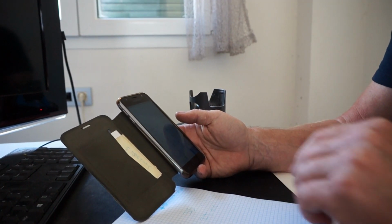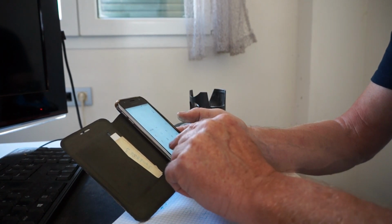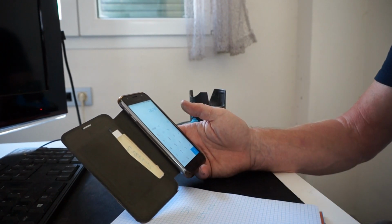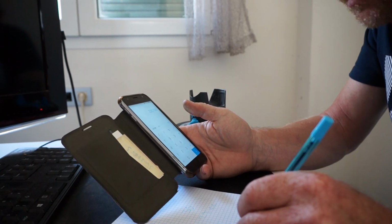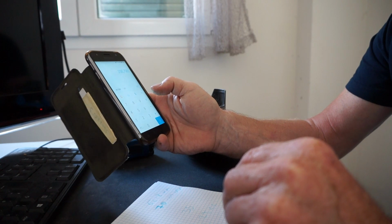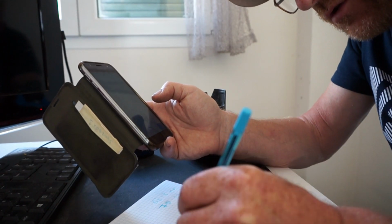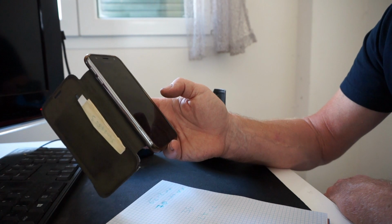Okay, so calculations time. So first of all, we need to work out our exact cubic capacity, which is 0.785 times 70mm, that is 35 times 35, times 60mm stroke, which gives us 230.79 cc. So we've got 29 cc's volume, but we have to remove 1 cc for the spark plug, so that now gives us 28 cc's. Remember, we measured the volume of the spark plug, so now we've got 28 cc's volume.